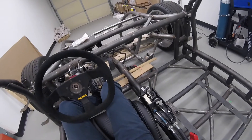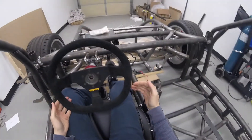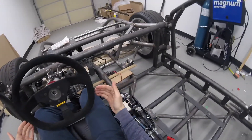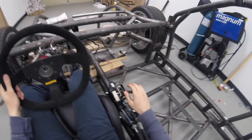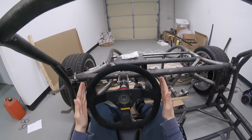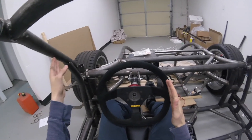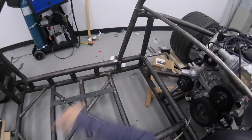I'm gonna have aluminum floor panels cut and bent so I can just lay them in, bolt them, and use double-sided tape for insulation. The shifter I put about a third of the way in from the full depth, so in neutral, moving the hand over to the shifter is in the same line, and there's elbow room for it to fit. If the seats are too close together there's lots of room on the side. I wanted the seating position for the driver so that the A-pillar is out of the way — I think this will be really nice to drive.